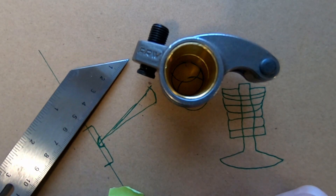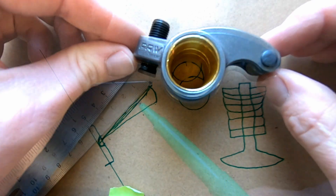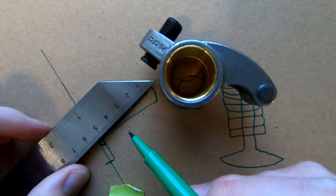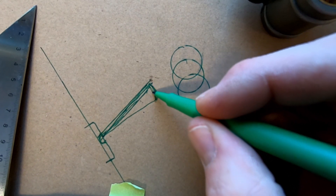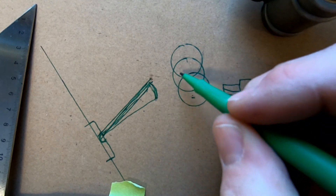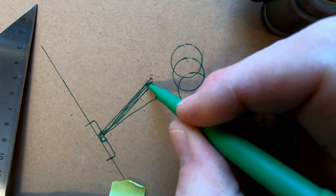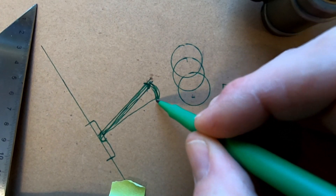We're going to need a longer push rod. Coming out of the center of the lifter bore again, when we go to a max lift situation — which would be downward — instead of having this big wide sweep of the lower shaft, they're shimming it up and out. When they do that, it decreases the amount of sweep, so we only have about this much sweep now instead of this big wide sweep.